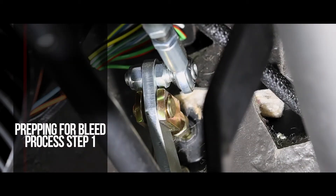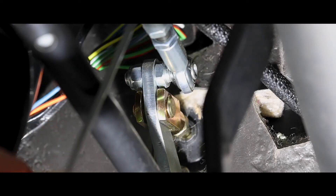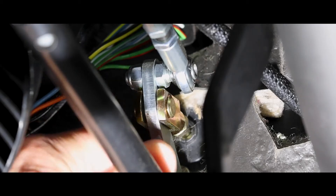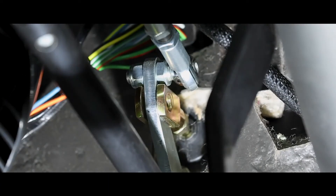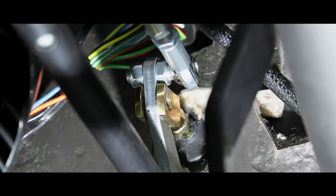We're going to take you through the first part of the instructions to disconnect the master cylinder rod from the reduction linkage. The part you're disconnecting is this gold clevis, pointing with the screwdriver. You're not disconnecting it from here and you're not disconnecting it from the pedal — the disconnection happens at this gold pin and this gold clevis. We're going to take out the E-clip on the far side and then push out the pin. Once the pin is removed, you simply go up and sort your setup for the bleed process on the rest of the linkage components. As you can see, the pin is removed, which eliminates any load that might be on the master cylinder rod itself.